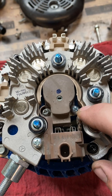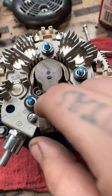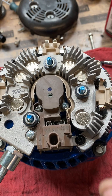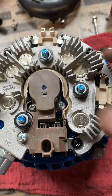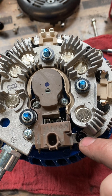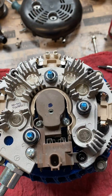Then underneath you'll see this. There might be some slight variances in where the plug outlet is or what plug outlet it is. The brush holder design might be different. You might see different heads of screws — I use T20s, some guys use Phillips, others use Allens. It really depends on what you have. The OEM is always Phillips.